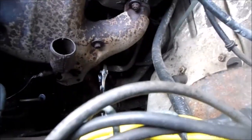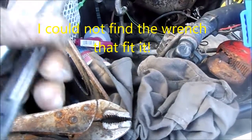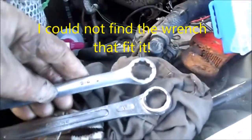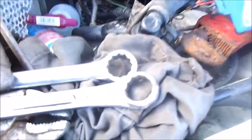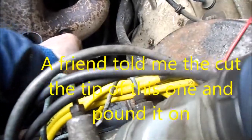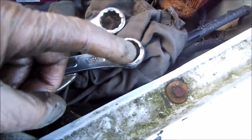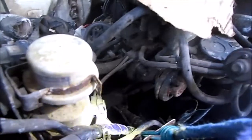So this one, it's just not happening. One friend of mine suggested — this is almost a cross between a 21 and a 22. What he suggested is that I get the nearest socket size closest to that EGR nut and then cut it off here just enough to slip around that tube, so I can get a pretty good grab on it. But I'd have to cut almost a third of it out in order to get it over there.